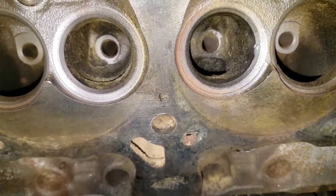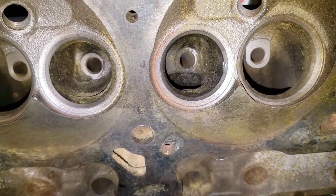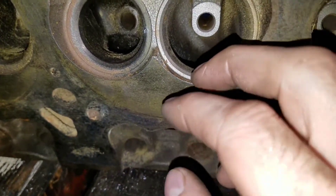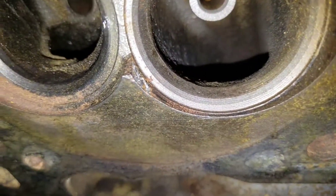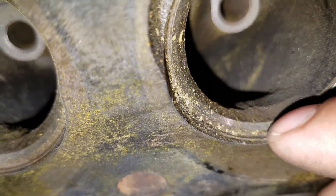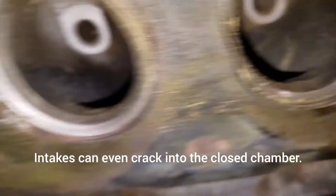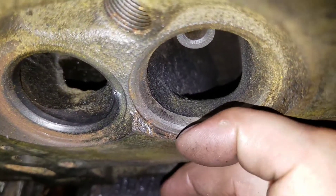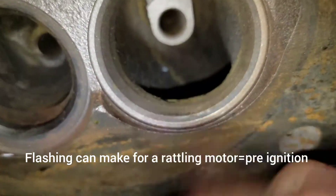Then I'm going to do my valve job on it, just to show what a really good valve job will improve. But then I'm going to unshroud that valve job. That's bad — that's from the factory. You could cut your finger on that right there. Tell me if this was detonating — look at that. The material's rolled over on that a little bit. It's ugly. Same with that one.